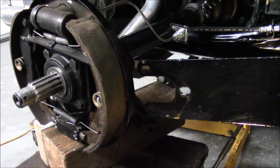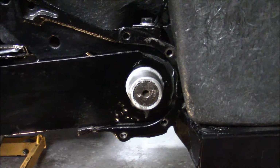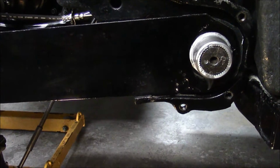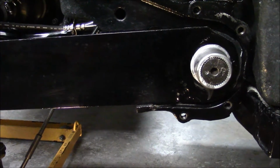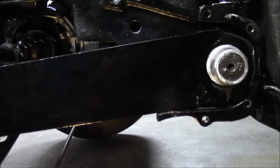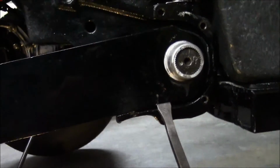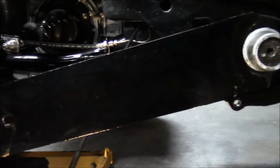The rest of the axle bolts were taken out. The axle's out of the way, and the torsion bar cover was removed. If you see somebody else's video that says to mark the location of the spring plate now, before it's off the stop, that's completely wrong. What you have to do next is pop it off right there. Then you measure the angle of it.